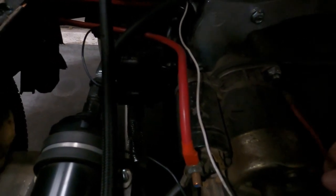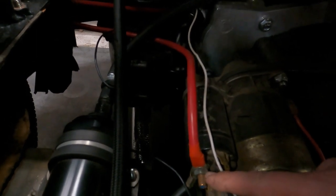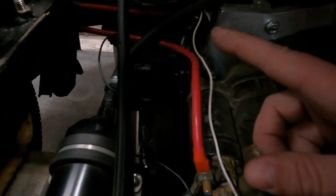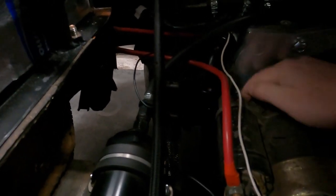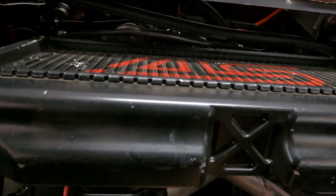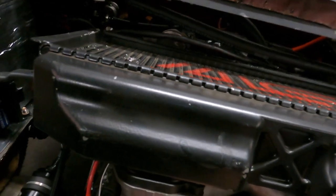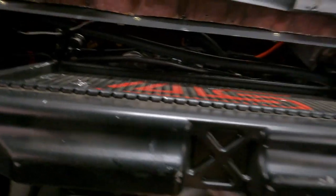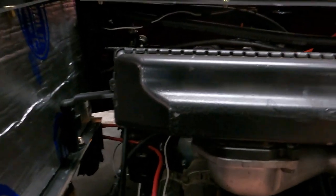Here's our starter. I disconnected the wire for the starter switch right here, and this was that post that connects to a fuse and then to the alternator. This other line here goes to the battery, so we'll disconnect that. Then we'll take out this bolt - there's one on the lower side. Hopefully I don't have to take out the intercooler. My intake air temps didn't get above like 80-90 degrees in all the driving I've done, so I'll leave it there until it becomes a pain.